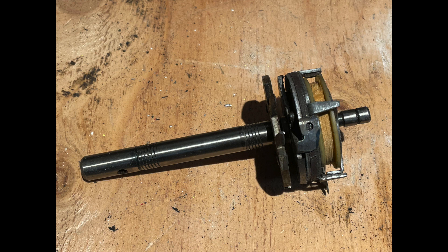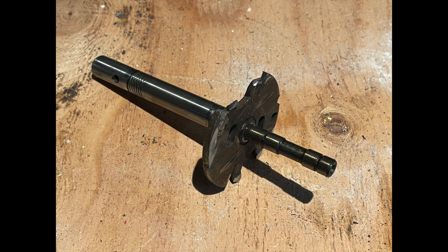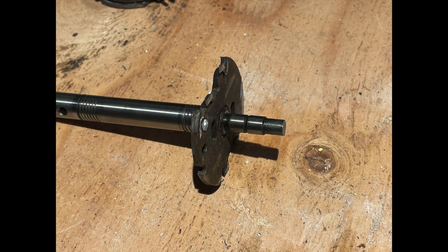The first thing I had to do was cut off some superfluous metal bits. I took the shaft and cut off some parts from the mounting plate, and I took the variable reluctance sensor and cut off three of the four metal stakes. These little stakes generate a pulse every time they cross each other, and that pulse is what the computer is sensing.